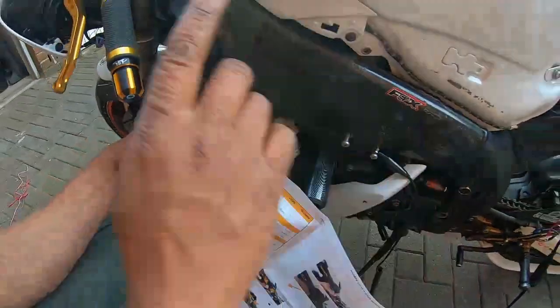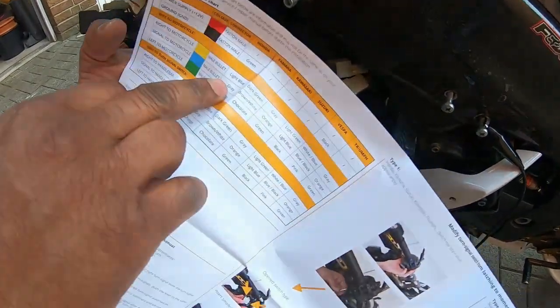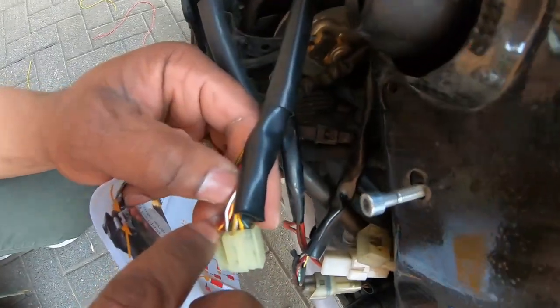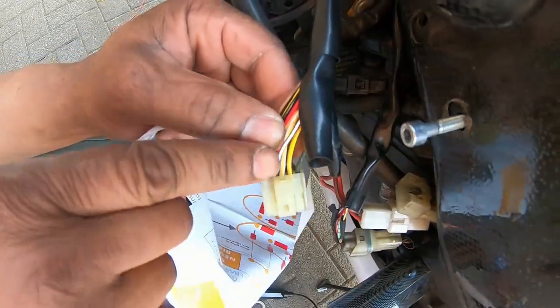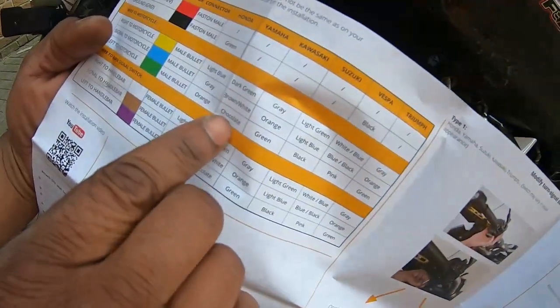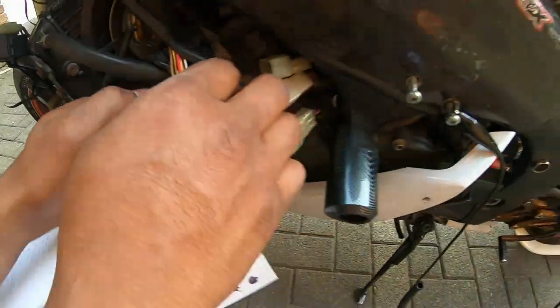The next wire is a blue wire, which is going to be connected to the brown-white wire. The brown-white wire is this one on top as well, with the dark green wire. Dark green wire on the far right, the brown-white wire is here. And the next wire you need to find is a chocolate wire — on Yamaha, this is the one.